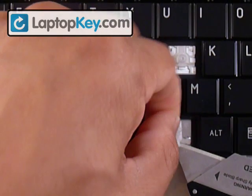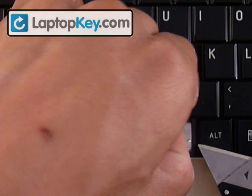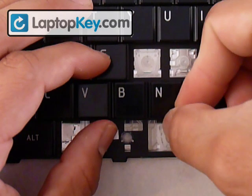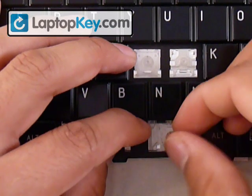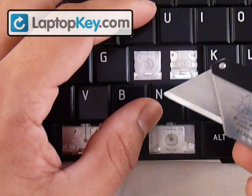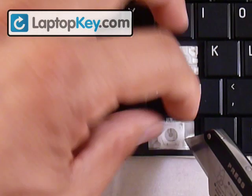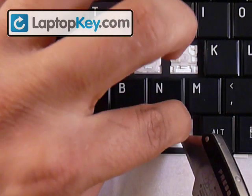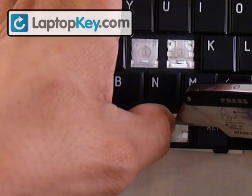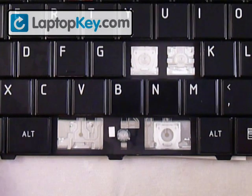Put this piece on top of the piece you've already installed, and pick up slightly on the plastic piece that's already on the keyboard so that the small piece has enough space to reach the hook. This is the piece that's actually going to stay underneath the large hook. Once you have that down, push down on the small piece so that the pin can go into the hole of the larger piece. Once you have one side in, use your thin object to separate the large piece from the small piece so the pin can go into the hole on the other side. You're going to have to stretch quite a bit, but once you have that down, do the same for the next side.